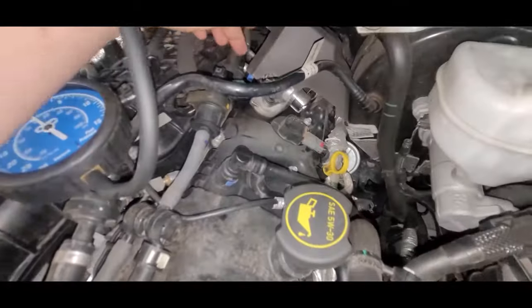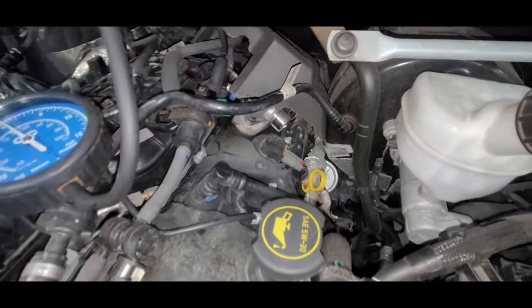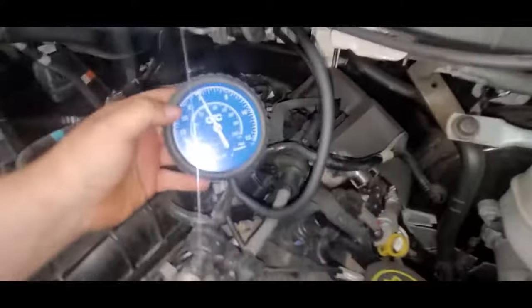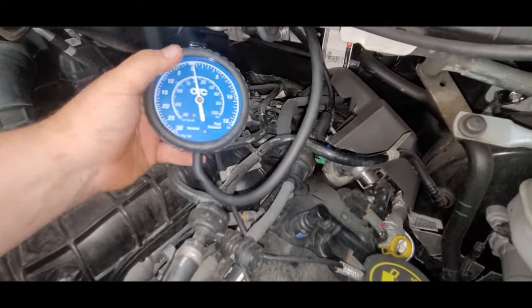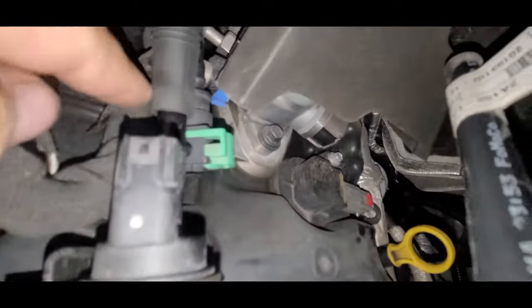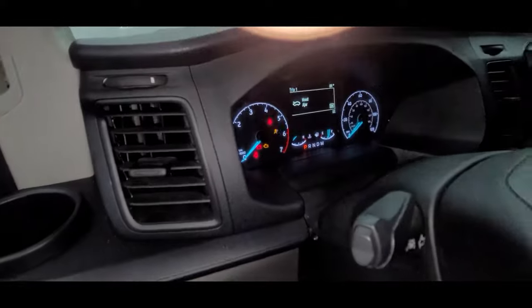Now, it's a little difficult. I would just put my finger over it normally to feel if it's sucking, because it's pretty obvious, but on camera it's not going to be so obvious. So we have our OTC vacuum pressure gauge. If we start it up and this is fitted over the end of the thing and we have engine vacuum, we know we got a problem.